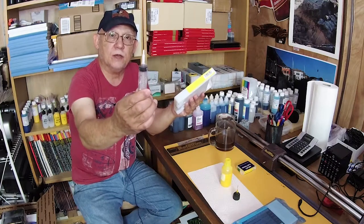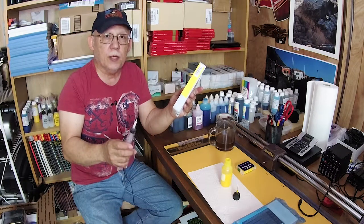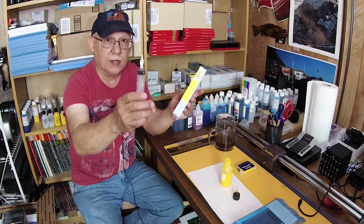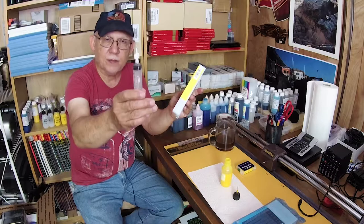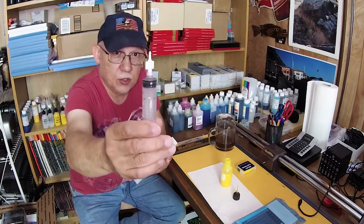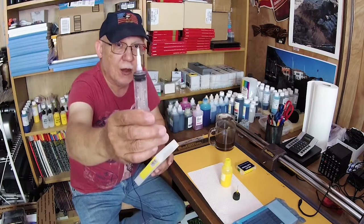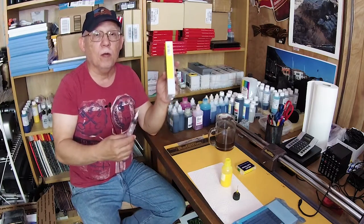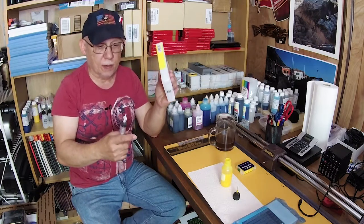You will need one of my special tips — I sell these on my special ordering site, the same one I use for the PGI-29 modified cartridges for the Pro-1. There's a link to order a set of nine for about $12.50 including shipping. These have been machined to contain a slot right down the middle. Those slots allow for lateral displacement of ink, whether you're drawing ink out or pushing ink into a refillable modified OEM Epson cartridge.